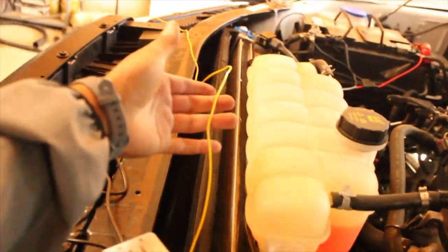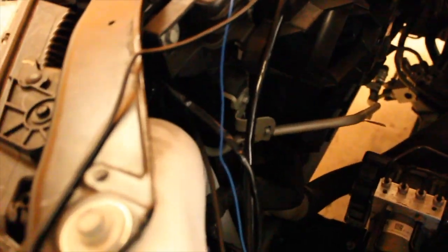You'll have the control unit box right here. This will have five cables total — three will be your power cords, and then two will tap into your turn signals. I got a blue one here that's already in my turn signal, and then I have the yellow one which I'm still figuring out. So back here you can already tell that I spliced into this connector a couple times. Here's what I determined: you'll get three connections. The black one is your negative and hooks up to the black cable from the control box. The middle one connects to the red cable, and the last one is the turn signal. So that's turn signal, power, negative — and it functions.